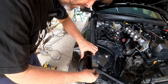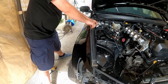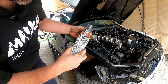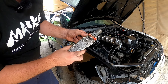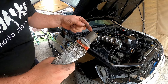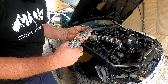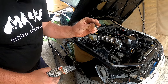The black actually makes it difficult for you to see. Three on the top, going back for an OEM bolt rather than the fancy ones. I do want some anti-seize on that. Got some LB8150 here — this is an anti-seize. It gets everywhere. You turn into Tin Man if you ever touch this stuff, but it's quite poisonous, I hear. This is going to stop it from getting stuck and also getting rusty, so you just put some of that on there and you're good to go.